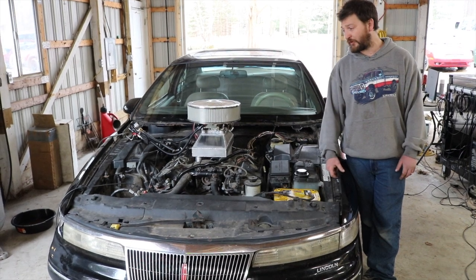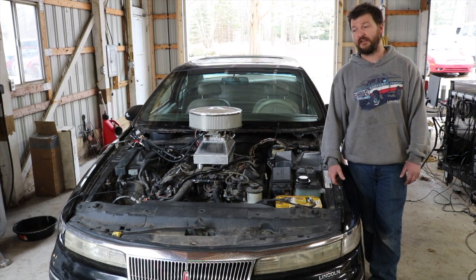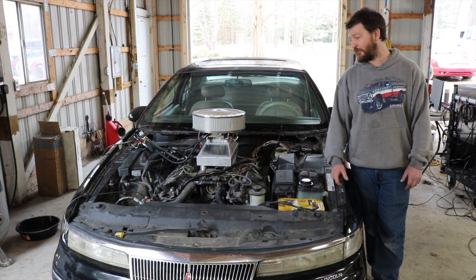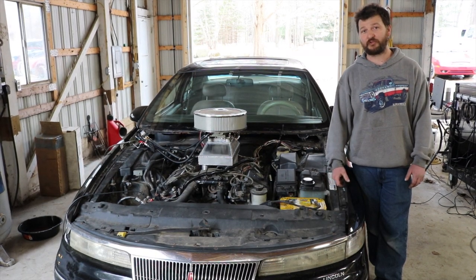But we learned a lot from it. It worked well and did ultimately make more power than the factory fuel-injected engine up top — it made a lot more power. Down low it didn't work that well. I think I can adjust that with intake runner length and plenum volume, but overall I'm pretty happy with it. It worked okay for a scrap metal intake.